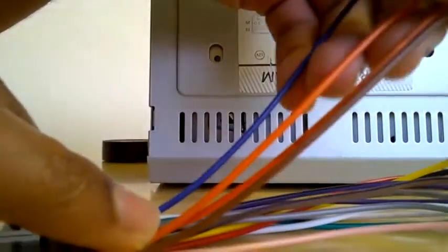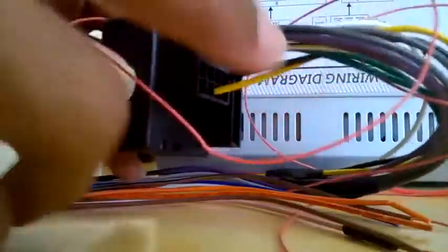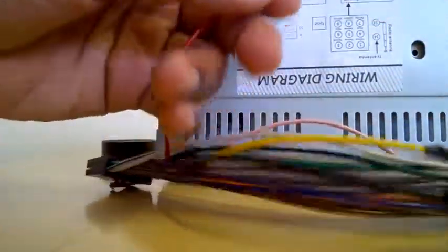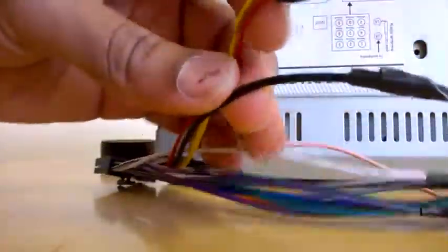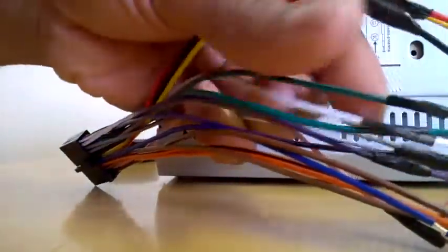You just need to follow the diagram and read through the cable labels — every wire is labeled, including on the aftermarket connector. For example, rear view camera connects to rear view power. The three most important cables are: the black wire, which is ground; the red wire, which is positive and needs to go to the cigarette lighter or any constant 12-volt source; and the yellow wire, which is also a positive for turning on the radio. With just these three, the radio and DVD will work, but you won't have any sound unless you also connect the speaker wires.